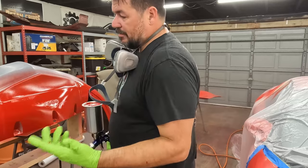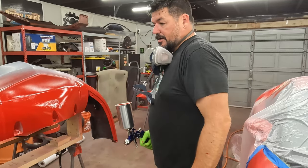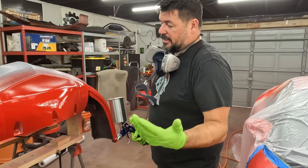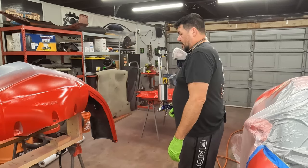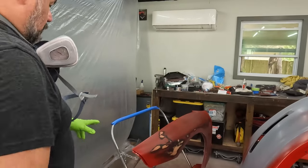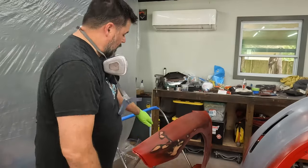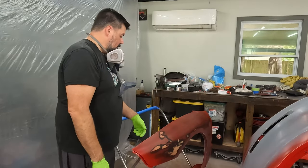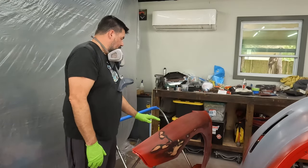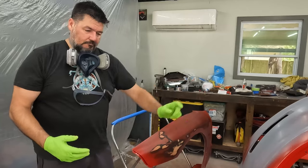It's spraying really thin, and maybe it's supposed to, but on the hood where those primer spots were, it's not covering it very well. I don't know if it's that I'm still moving too fast, or maybe it just needs 3 coats or more. Let's give this another 5 or so minutes to flash, and we'll hit her again. But I think the fender I'm going to call good with 2 coats. It's just to make sure that when you look between those cracks, or on the inside of the hood, it's not going to be burgundy. It's not a great paint job inside the engine compartment, so it doesn't have to be great here. So I think I'm good with that. And if I get it on the car and it doesn't look quite right, then I can touch it up.